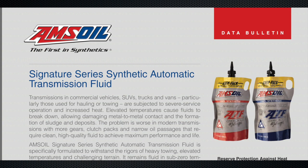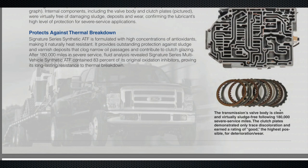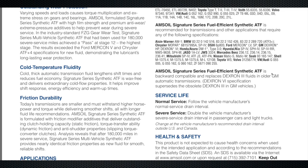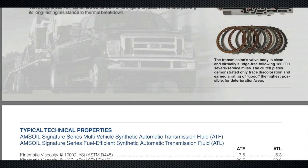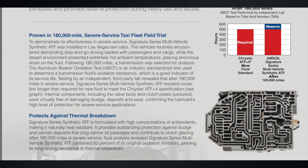The fluid we'll be using today is the AMSOIL low viscosity ATF. It meets and exceeds all the specifications for the Toyota WS. This fluid will run usually 20 to 50 degrees cooler than petroleum-based oils and extends the life of the transmission significantly. There's also information about a taxi test done on transmission fluids out to 180,000 miles, which is very revealing as to how the fluid performs.